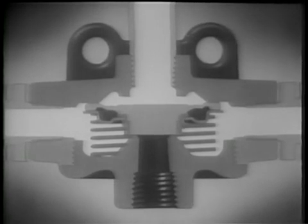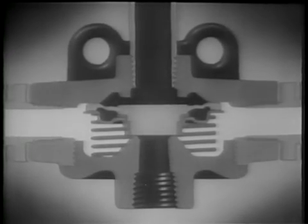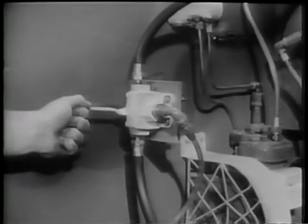When the brake valve is released, there is no pressure above the diaphragm, so the spring is able to return the diaphragm to its seat. This blocks off the passage back to the brake valve, but opens up a shortcut that leads directly to the outside. The air in the brake chambers escapes quickly, without traveling the long route through the air lines to the brake valve.